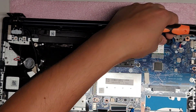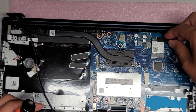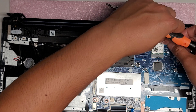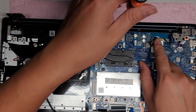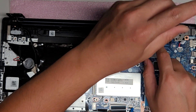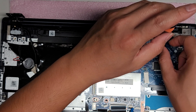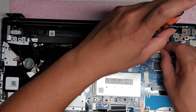Let's take the wireless card out. I'm actually just going to disconnect the wireless card and leave it attached to the antennas. If you want to see how to remove the antennas, you can watch the other video I did, because I'm going to leave the antennas attached. Basically, you pull up from the tail and it will come out. Phone overheated — I'll be back.